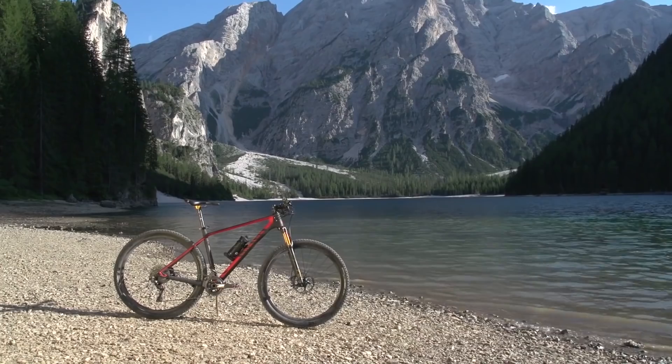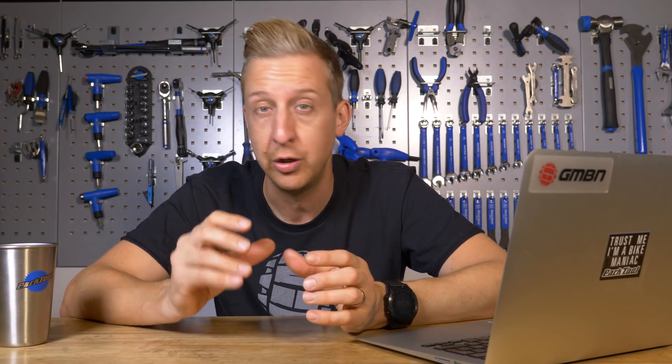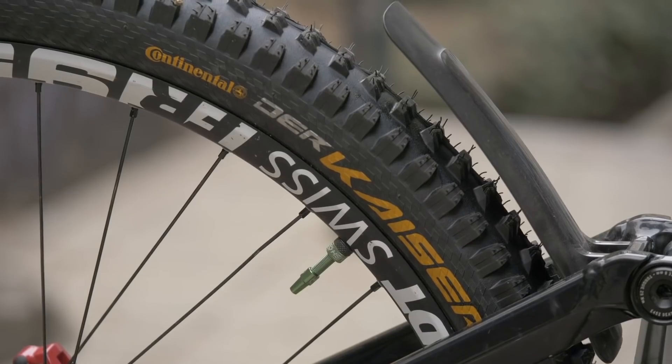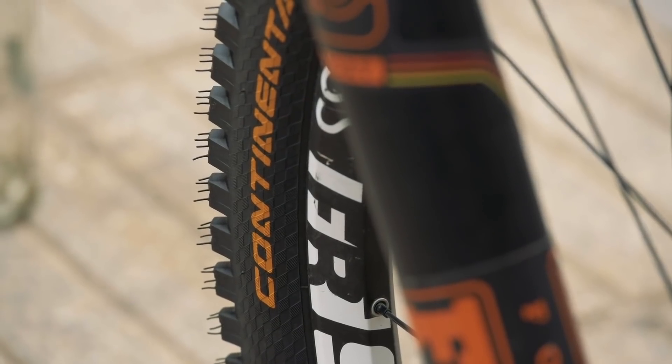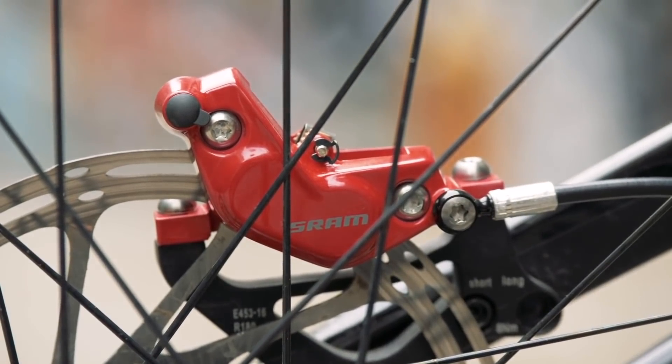And finally, your bike and your riding style. Using two complete opposite ends of the spectrum: an XC bike is typically very lightweight with minimal rolling resistance on the tires and not much suspension. With a bike that doesn't weigh much, really powerful brakes will lock the wheel up before you slow down extremely fast. At the opposite end, downhill bikes are very heavy, have tires with extremely soft rubber, run at very soft tire pressure, heavily lugged for maximum traction, and up to 220mm of suspension travel, giving you all that extra grip. That means you can have the most powerful brakes possible — like a set of Z brakes with enormous disc rotors — and use it all across multiple terrain types including wet roots and rock.